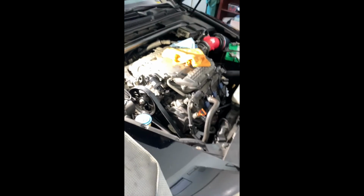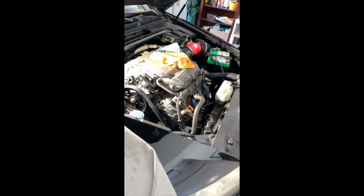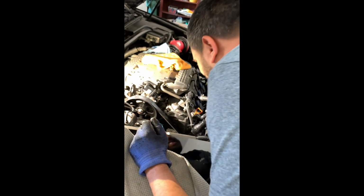And confirm one more time, make sure, whoa, sorry, losing you guys. To make sure that everything is on the rails. The belt is on the rails of every pulley. Sorry, this is such a bad video, guys, I'm sorry. Okay, so that's good, crankshaft is good, AC is good. Idler is good, alternator, and the belt is on the tensioner, and obviously the power steering.